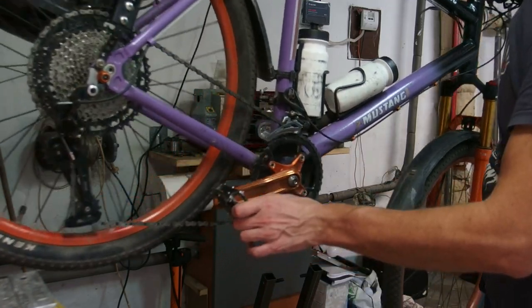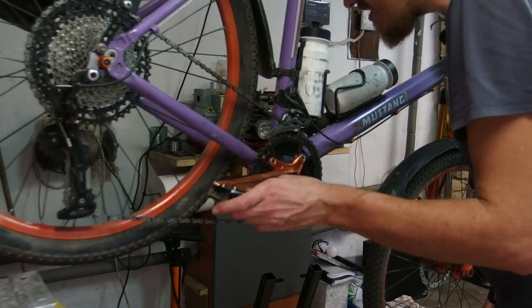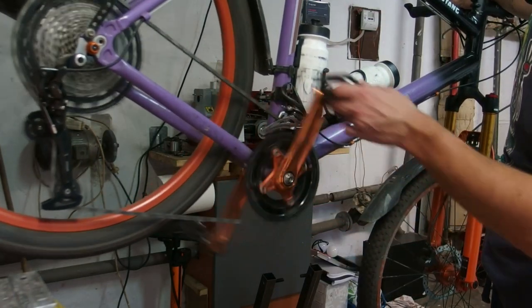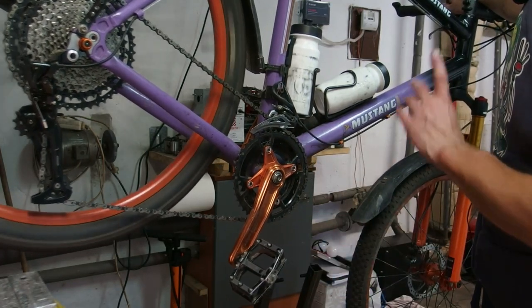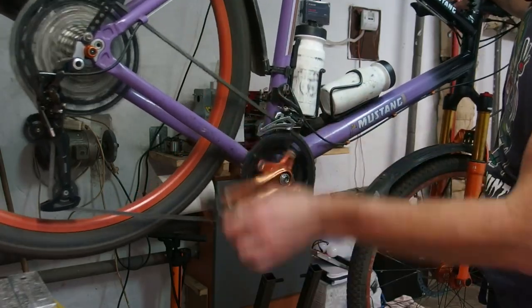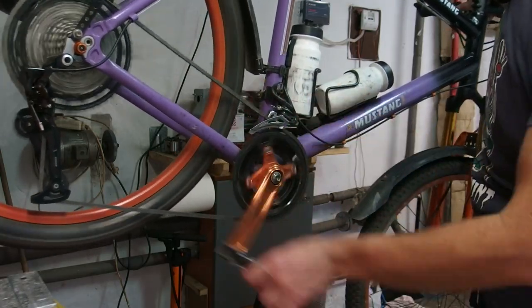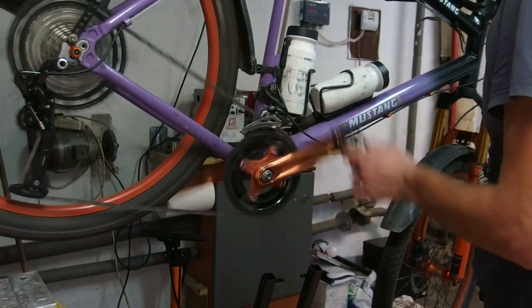And of course the cassette is wider, the chain is fairly short, so I have a little bit of a rub on the front derailleur. However, I've got a thumb shifter with no indexing, just micro indexed, so I can compensate for this, and as you can see, I've got full access to all the gears on the big ring. Now let's go down the block.